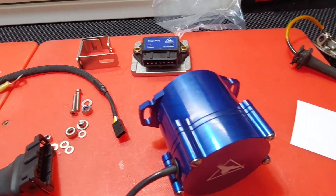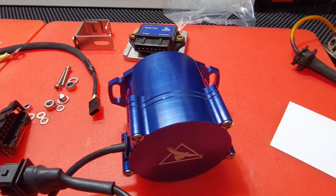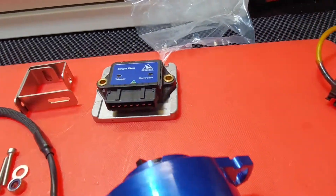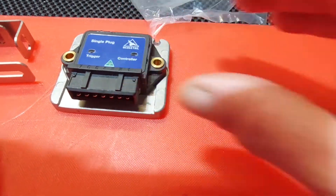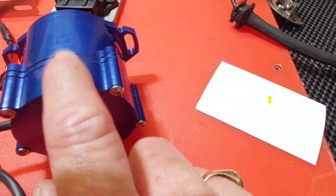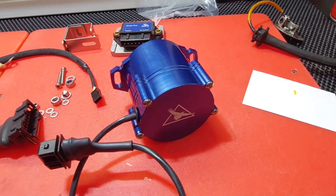Now that's all you need. Inside here it's all electronic, and this can be specified factory fitted with twin hall triggers and a switch on your ignition module which is here. There will be a switch on this side of the module, which if your hall trigger fails when you're driving along the road, you are able to flick that switch and bring in the second hall trigger that will be installed in there.